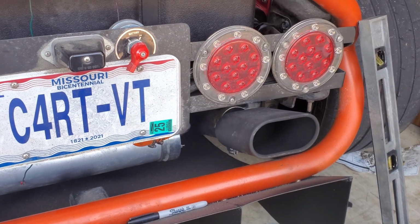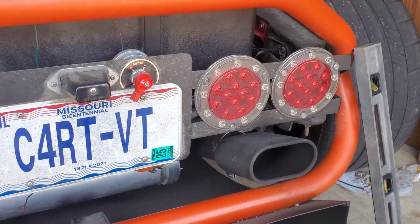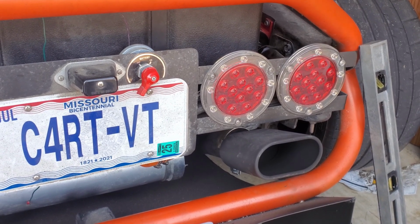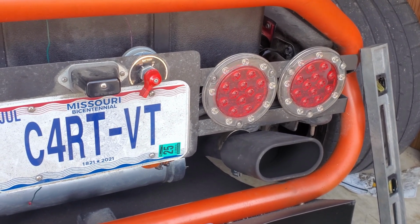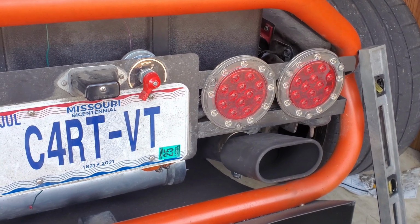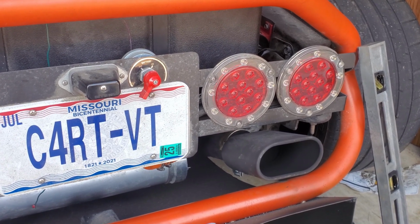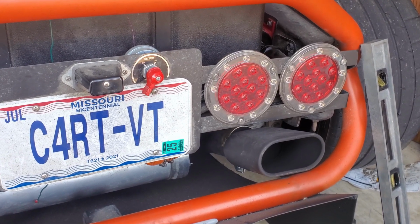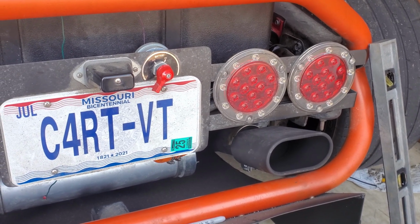Next, we are gonna fabricate up a heat shield. I know I talked about this a few videos ago, never got around to it. And I've noticed a couple of small issues. Generally, I'm seeing about 74 PSI of pressure at the fuel rail. That's kind of what I expect, somewhere in the low 70s. In my track session out at Worldwide Technology Raceway, I saw a data log that put it as low as 69 at one point, which is slightly concerning, but not overly concerning.